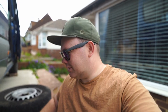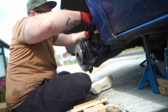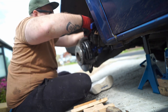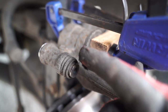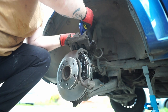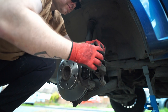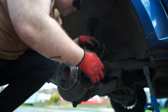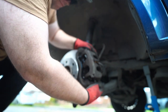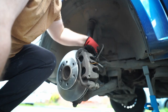I need to push the pistons on the caliper back. A really easy way to do that is with a bit of wood and some G-clamps. Now the pistons are pushed back into the caliper, I can take the G-clamps off, take the bit of wood out, and it should slide straight over the new pads. The suppliers of the pads also gave us new bolts, so I'll use those new bolts in the back of the caliper.